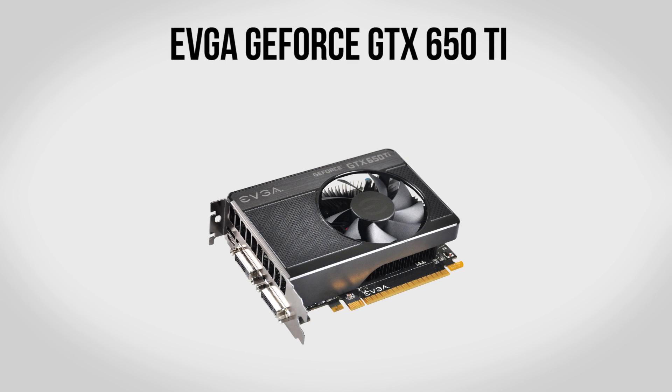For a graphics card we're going to be using an EVGA GeForce GTX 650 Ti. This is a fantastic mid-range card that will be able to play games such as Crysis 3 and Battlefield 3 and basically anything else you throw at it. It supports 1 gigabyte of GDDR5 memory — there is a 2 gigabyte version, however I find that to be just a little overpriced so I stuck with the 1 gigabyte version. It is also very overclockable and supports up to 3 monitors, making it a very solid card for about $150.